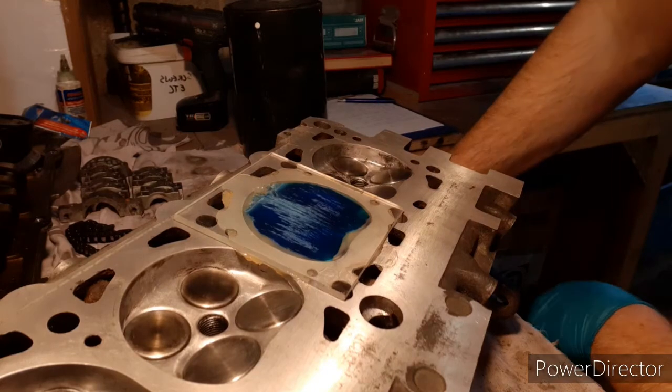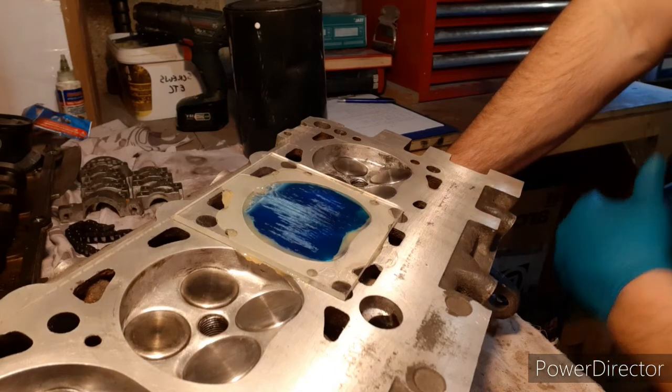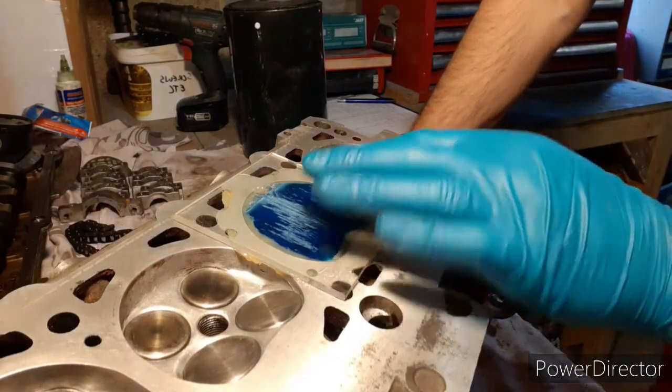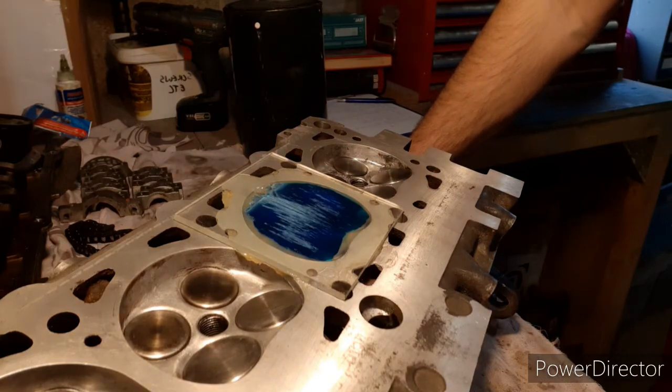We write those measurements down — 45cc in the bowl, 118.1 millimeters on the head thickness — and use those later when we come to rebuild the head and engine. Once you've got that reading you'll do a similar thing on the block once the replacement pistons are in, and all those measurements together will give you the actual compression ratio the engine should produce. Unless you want to run high compression — which on this engine I doubt — it will probably be on carbs or K-Jet depending on where it ends up, possibly in a caddy with some 45 Webers.